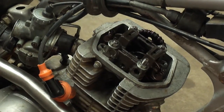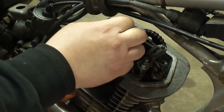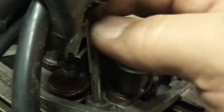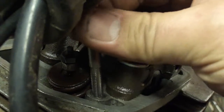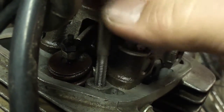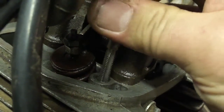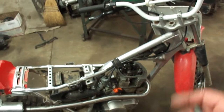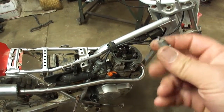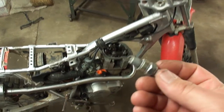I'm also going to take a tap down through this hole. Looking at the angle of this tap, I would say someone tried to drill this and did not do a very good job. This thing may need a head. But instead of going down that rabbit hole, I'm just going to thread the spark plug back in, put that cover back on, and let's just see if we can get it to make some noise.